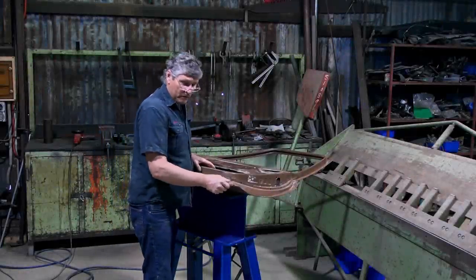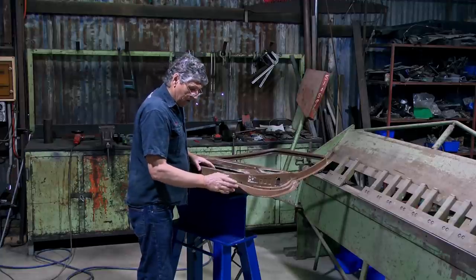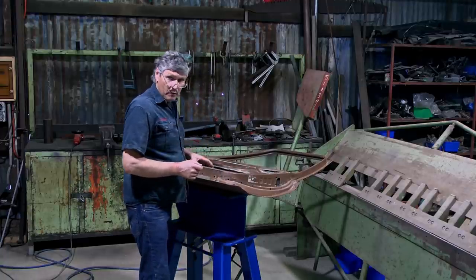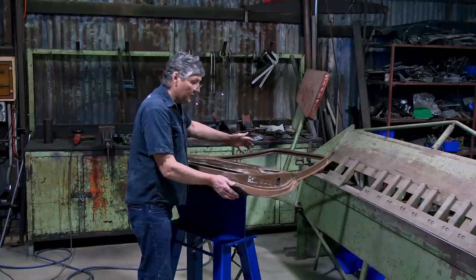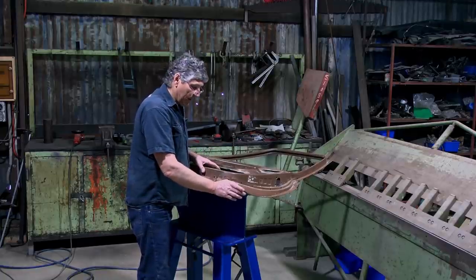If we're just ripping this skin off, the smartest thing is to run around here with a grinder — I suggest an electric angle grinder with a grinding wheel — that's the quickest way. Grind through the edge and the skin's going to fall off no worries. But if we were taking this off and we wanted to repair a complete door skin and put it back on the door, we need to be able to take this skin off without damaging it.